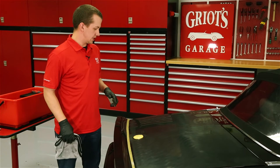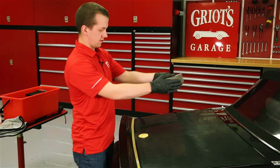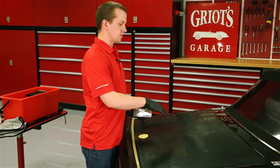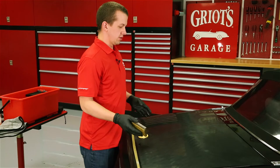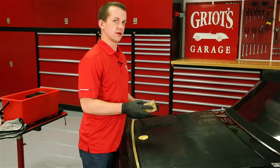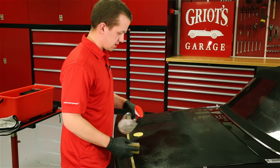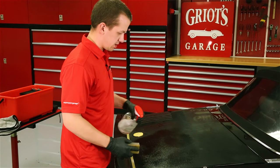So now we're through with the 2,000 grit step, finished out the whole deck lid with that grit, and now we're going to move up to 2,500 grit to finish it out. With 2,500 grit, since the previous step we were sanding in this direction, with 2,500 I'm going to sand in the opposite direction. That will allow us to see whether we're fully removing the 2,000 grit sand scratches, so we know when to stop. Normally your first sanding step is going to take much longer than subsequent steps, so being that I did three to four passes with the 2,000 grit step, I should be in about a two to three pass range with the 2,500 grit step. I've got the 2,500 on the block and this time we're going to work towards the front driver corner of the car.